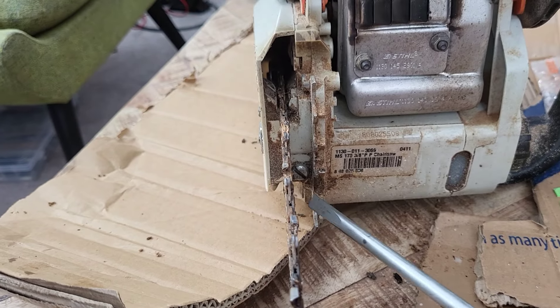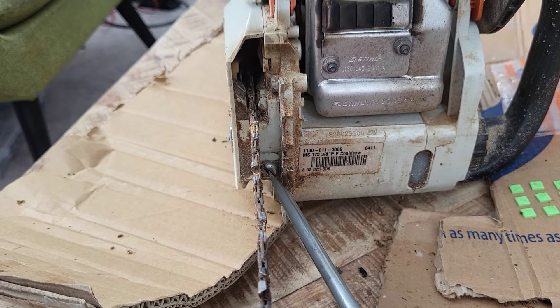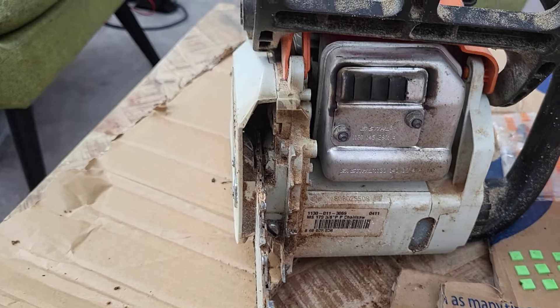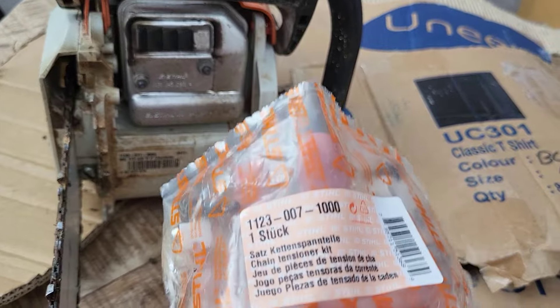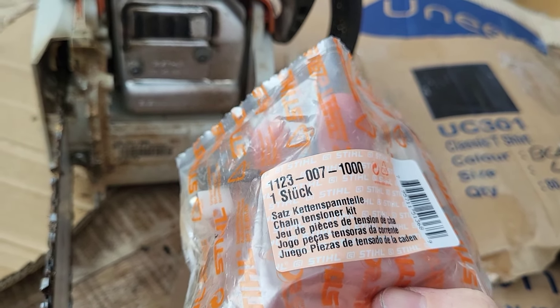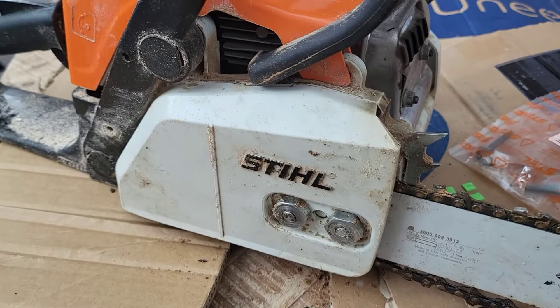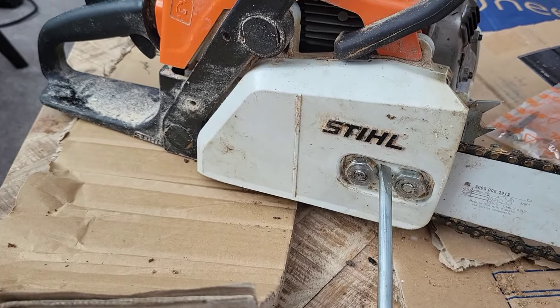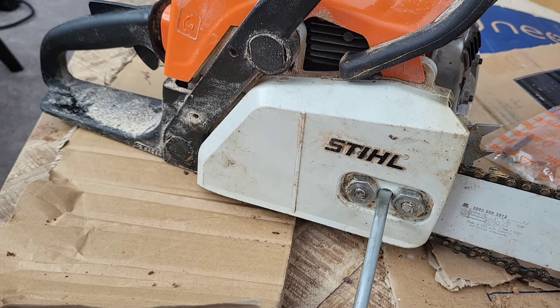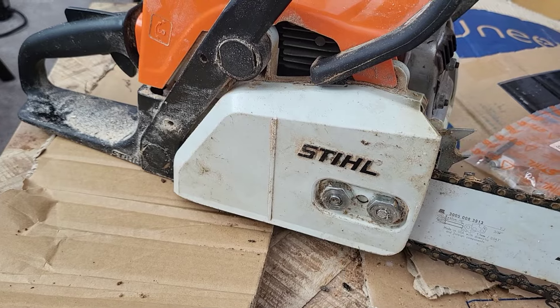It's always a little bit fiddly — you've got to get your screwdriver down here and just adjust it that way. So I saw a video where you can get this upgrade kit. The part number is shown here; it's about £23 on eBay. What it means is that you can tension it through this hole here, so it's a lot easier — you basically loosen these two, give it a chain tension.